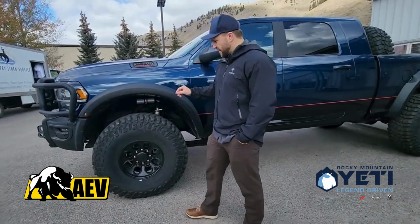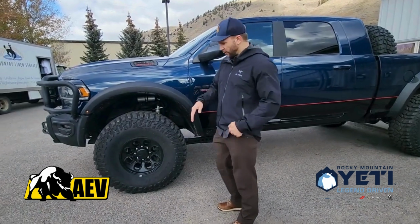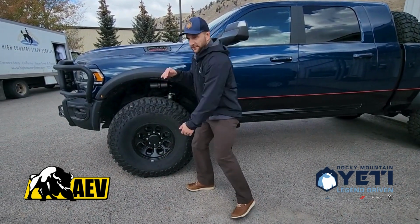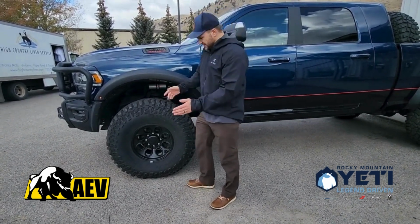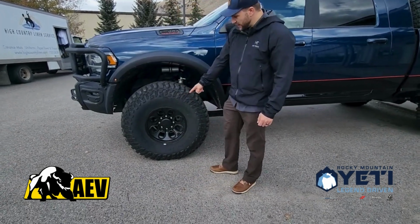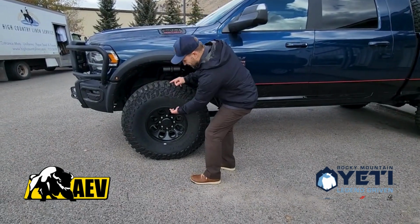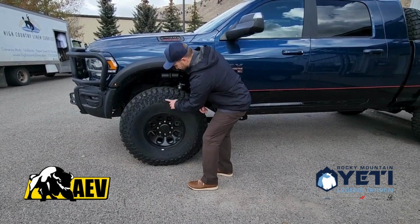You're talking about the tire size. It's a 40 by 13.50 by 17. Those numbers are in inches. So 40 top to bottom, okay, diameter. 13.50 is 13.5 inches wide. 17 is the wheel height. Now, we only give you a 17-inch wheel intentionally because we want to give you this sidewall. This sidewall is the distance from the top of the rim to the top of the tire.